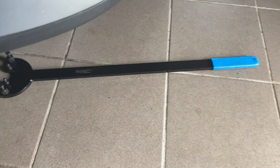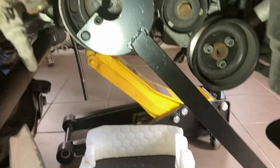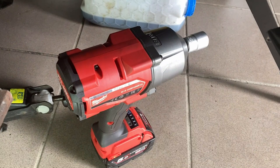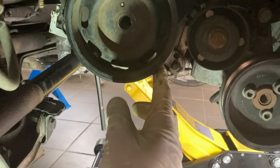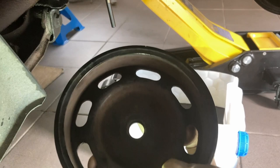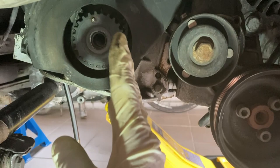Let me show you how I placed it — towards the floor. You may say I need some leverage there, but the big boy is all you need. Taking the pulley out is not much of an issue — just wiggle and it comes out. I already did it; it didn't take much effort. To align it later, there's a little hole I'm hovering over. We need to keep in mind one more thing — I produced some torque counterclockwise, so the engine is no longer aligned to TDC and we must fix that.